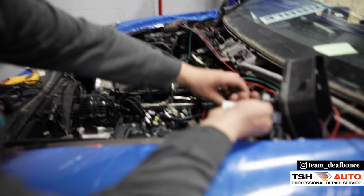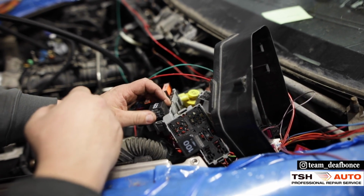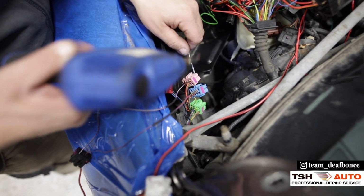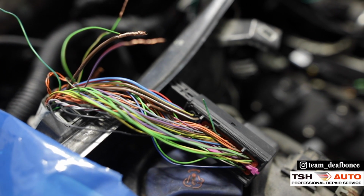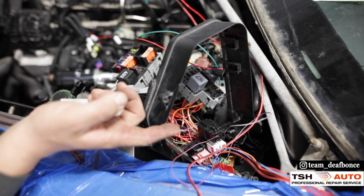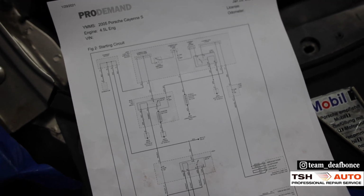So this one is basically our starter relay, but it was going to the anti-theft system inside. So what we did, I'm gonna solder everything here with a plug which is coming from the old ECU, because it's already wired there, so we're gonna connect there. And also here is a fuel pump, it's gonna be connected too. I'm gonna use the wires from there to operate the relay.